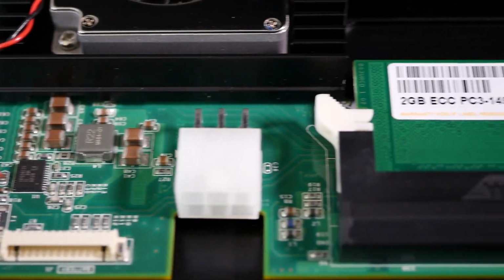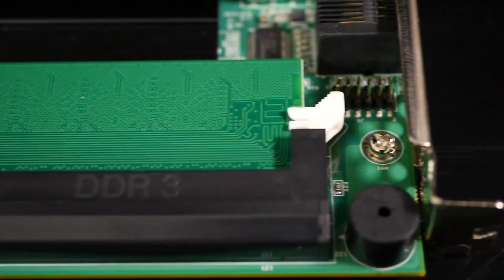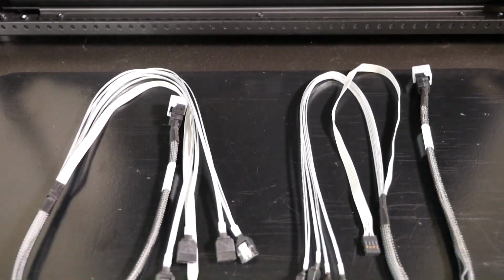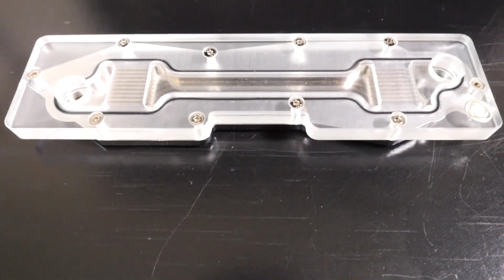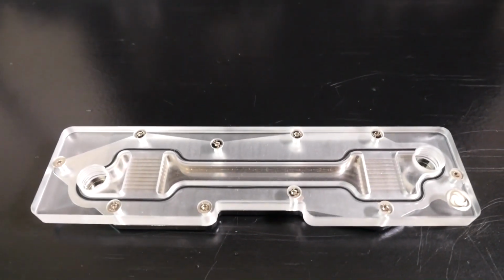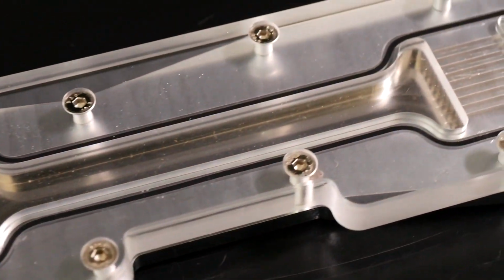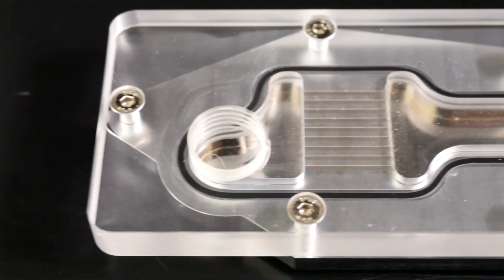I mean, now you can see what I mean by this is going to be a practical workstation build. You know, there's a lot of extra cables running the 20 hard drives. Something else that was very important to the client, these RAID cards run quite hot. Water cooling for the RAID card. And you can see that we have built another custom water block for the RAID card.